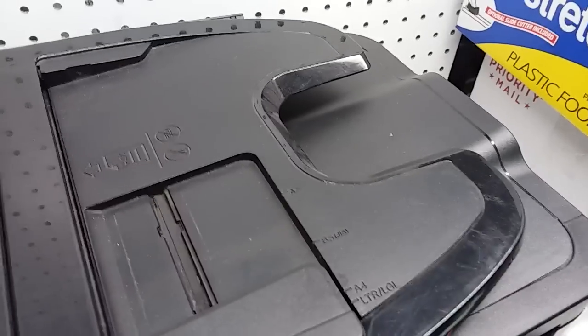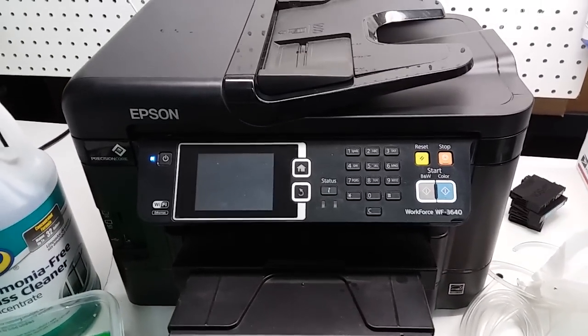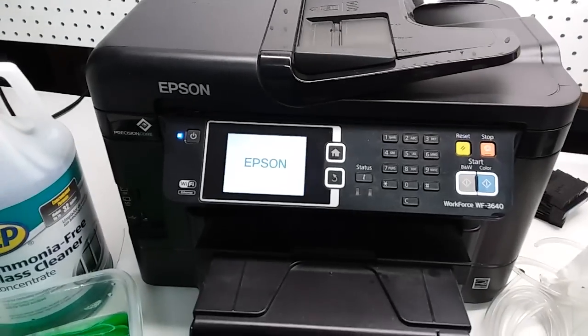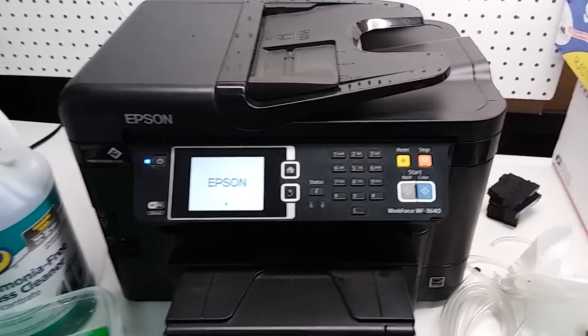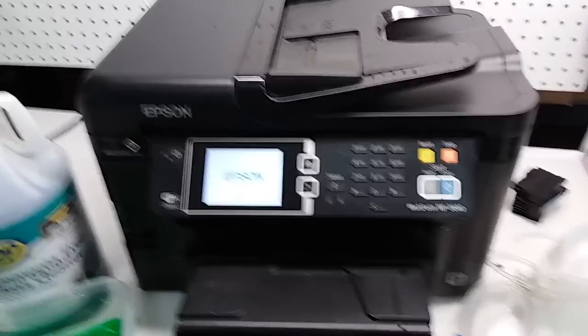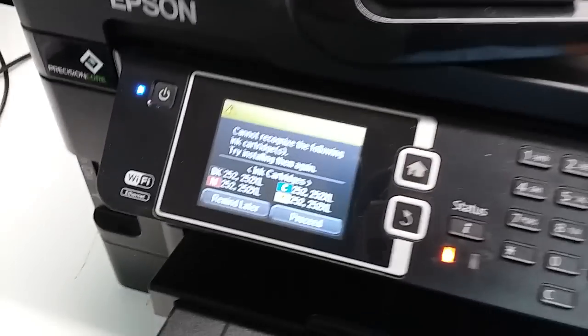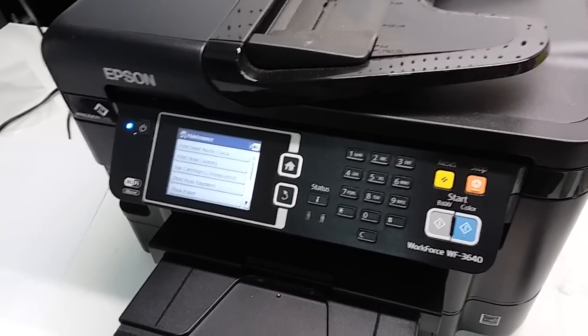Looks pretty good now. Manually slide the print head off the paper towel and remove it. Then plug the printer back in. Once the printer turns on, it's going to ask for the ink cartridges — go ahead and install them and let it run the ink replacement cycle. We'll print the nozzle check after that. It may give a print head clog message; just ignore it by hitting OK and proceed with installing the cartridges.